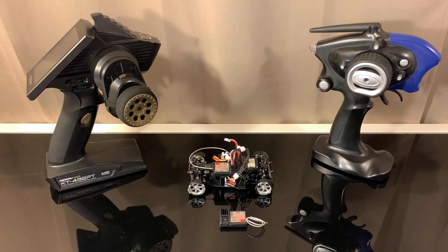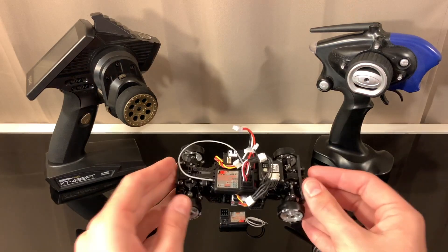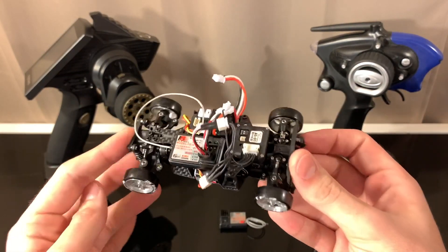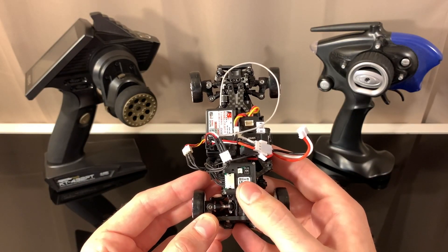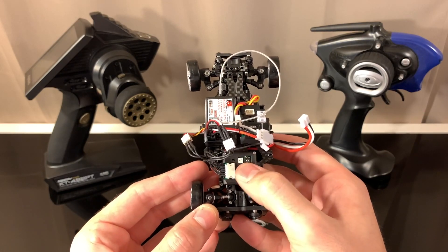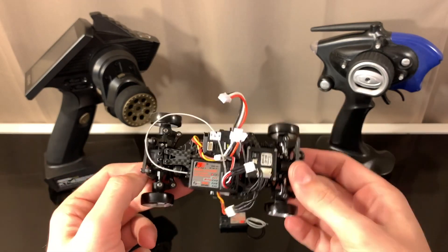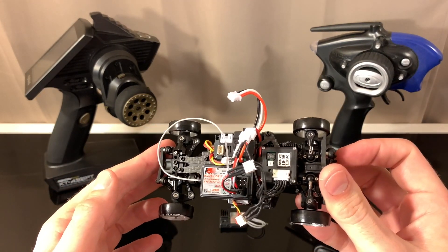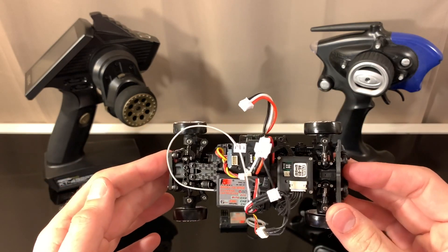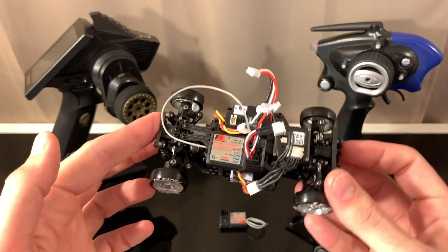What's up YouTube, BMR here. Today I'm bringing you a slightly different video than planned. I had planned to have the DRZ up and running for a test drive, but unfortunately I'm having issues with my gyro — the gain setting seems stuck at zero no matter how much I change it or toggle channel three. So the car is basically undrivable right now. I'm in contact with Atomic, hopefully they'll send me a replacement gyro. I tried to drift it and it just loops so quick you can't recover it.